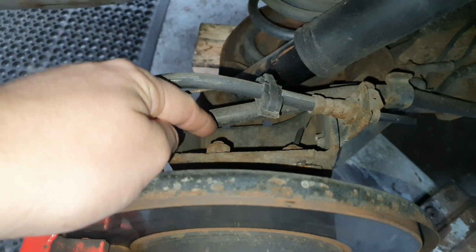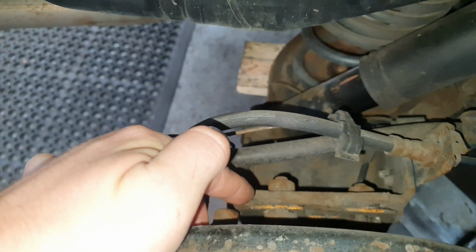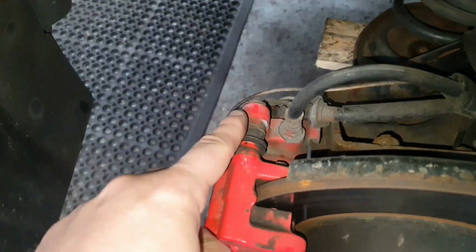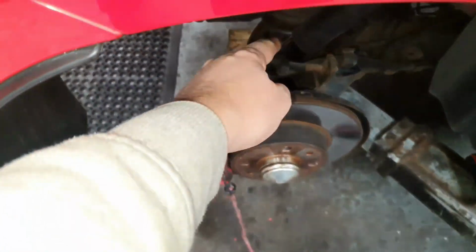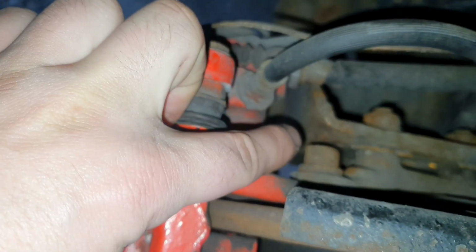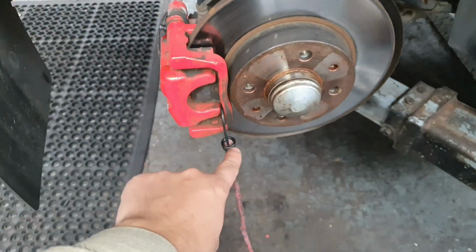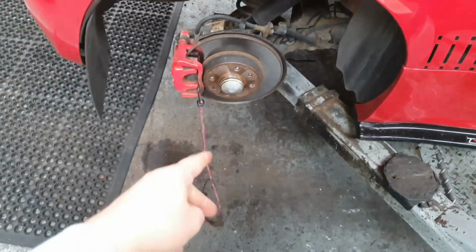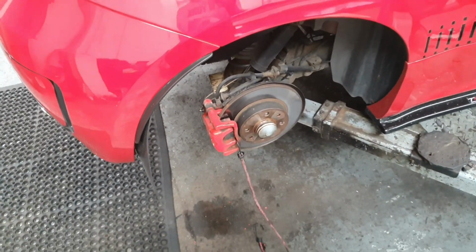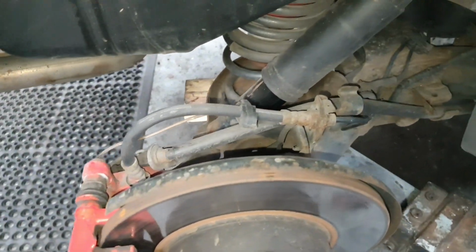You've got to remove the bolts at the back of here, where there's a camber plate, just at the back. So you've got to remove the 4 bolts behind there. And then also we've got to take this whole thing off. You can just about see this bolt here, and there's another bolt at the bottom. And that's to hold this particular part on here. So I've got an elastic there to hold it all up once we actually get it loose. But that's a little bit of an issue to get it up. It's a bit of a pain, but we'll crack on and get that done.